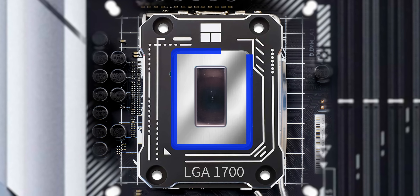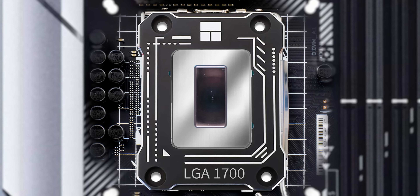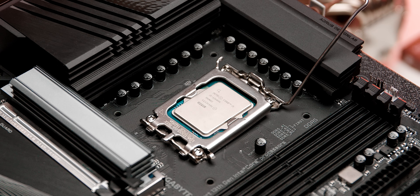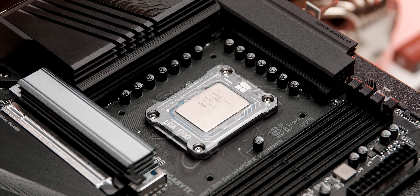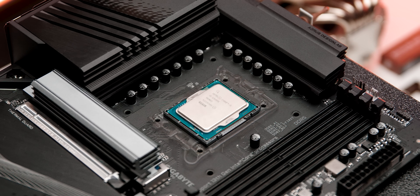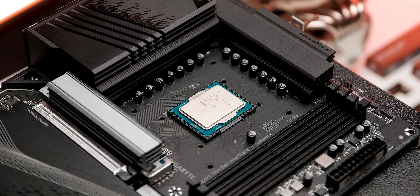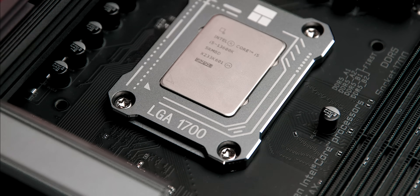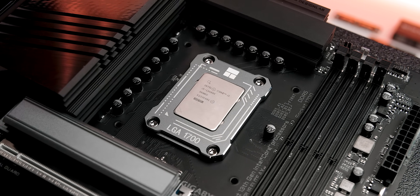The idea of a contact frame is to secure the CPU in place with even mounting pressure on all sides — on a brand new processor it prevents warping over time, and on an existing one it can reverse warping. Installation is simple: use the included hex tool to remove the four screws holding down the stock ILM, then screw down the contact frame. You can reinstall the standard hardware any time. One quick tip: if you're worried about damaging your socket, install the CPU before removing the ILM to protect the pins. According to a few reports this can void your warranty, but I can't independently verify that, so do this at your own risk.